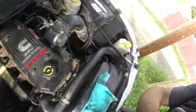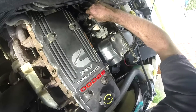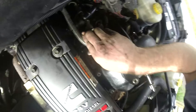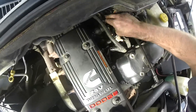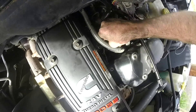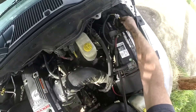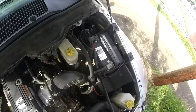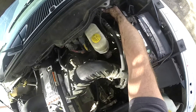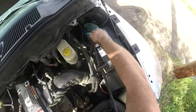Here is the breather hose - this goes above it, just got to wiggle it in place. Done. And this is the PCV or another breather. And here's that starter wire - I'll take my jumper out. Done. Reconnect. There you go - make it roll and make it click. Just wipe off anything you might have left behind.